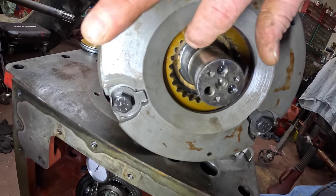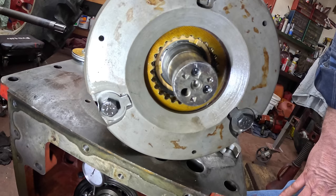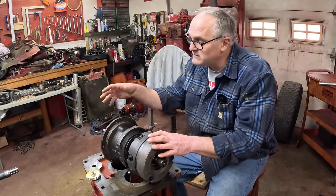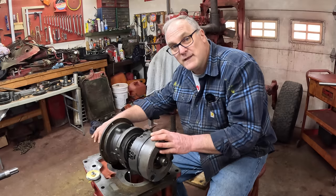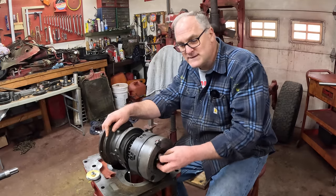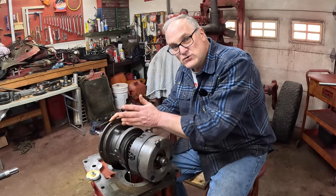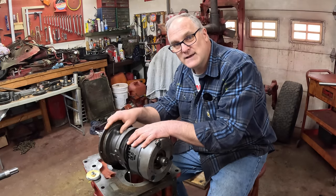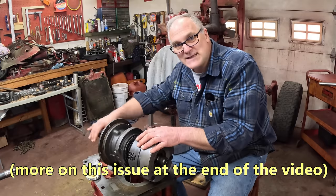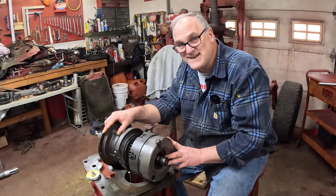Looking at the old TA, there are three direct drive clutches, and that snap ring at the bottom is where they put that spacer - in case you literally run into a bind with your TA. Another fascinating thing I learned: I've seen guys measuring end play on the pilot bearing end of the TA. I asked Joe how that could work, since you're really getting the play at the quill end. He's had discussions with High Capacity to change their instructions because measuring from the pilot bearing end doesn't give you what you really need - you want to know the end play at the quill end to make sure everything stays engaged with the clutches. It's fascinating when you get into these things.